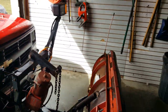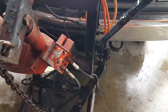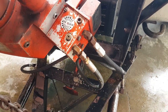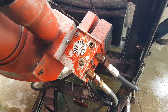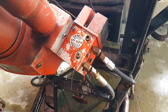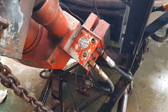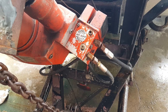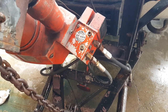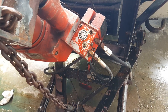Once I got all the lines replaced and primed by going left and right, right here are the two bleeder valves that you can manually use if the automatic version is not working. What you do is you push one side all the way in, open up the valve for that side, and then move it to the right. Do that until fluid squirts out. Sometimes it will squirt out quite a bit once you get all the air pushed out, but that's the fastest way of getting the air out. Now it will work just fine.